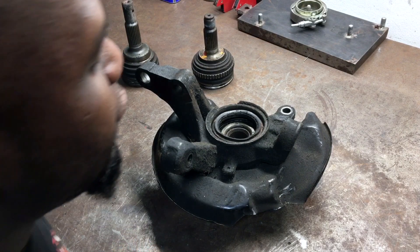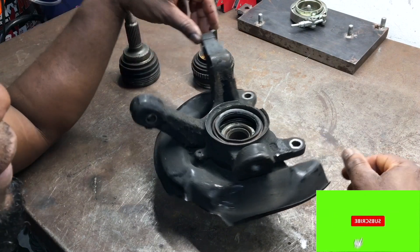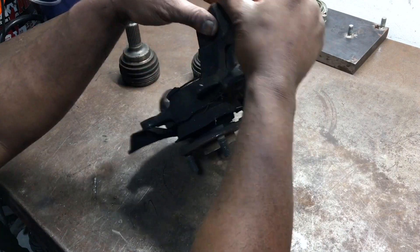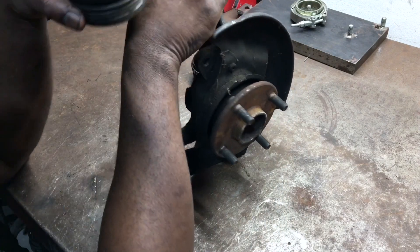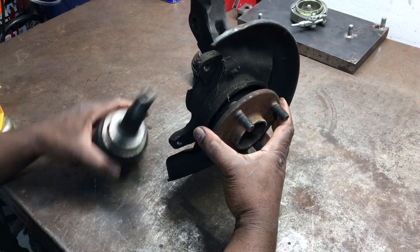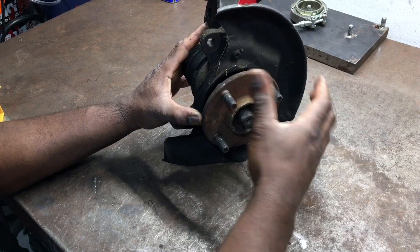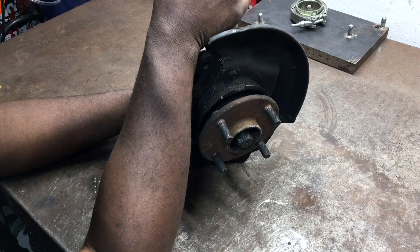We finally got the actual situation figured out. I went ahead and pulled the hub on the FX16 - this is the stock Toyota hub. The issue we're having is when you put the output shaft inside - this is the stock Toyota output shaft - I'll put it through the back so you can see how far it comes through. You have plenty of thread to catch your nut, but I can't use a stock output shaft on this setup because my axles already come with the Honda one.